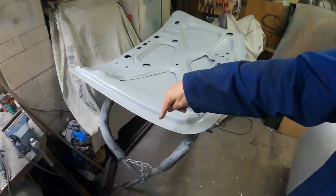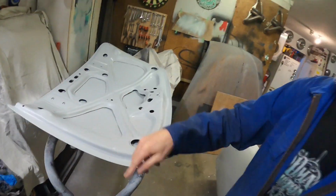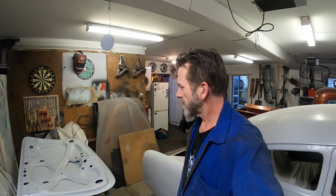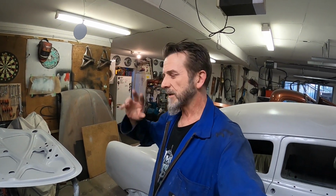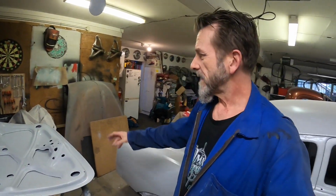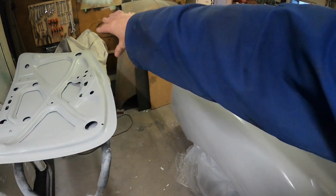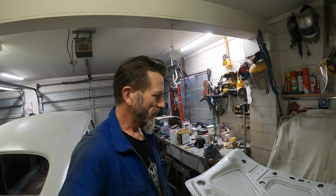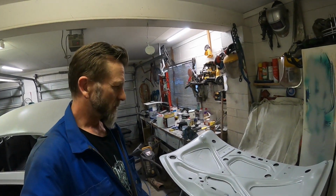I want to seam seal this joint all the way around. I don't really know why, just because it stops stuff getting in there and swelling those joints. And there was already a little bit of it happening down the bottom edge that I hammered down earlier in this video. Little bug, little midgy, tiny little thing. I might like the smell of this paint.